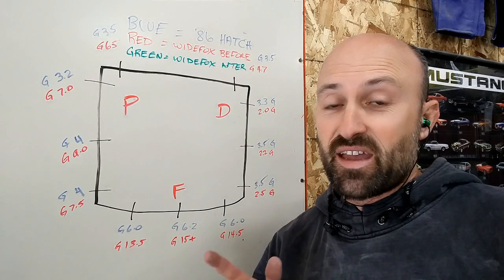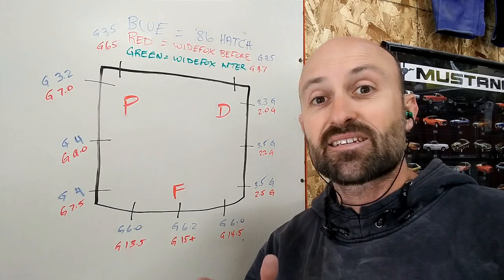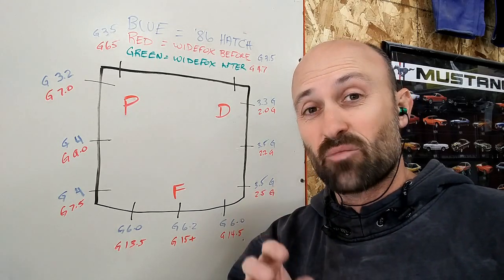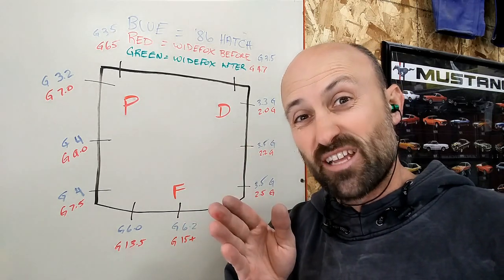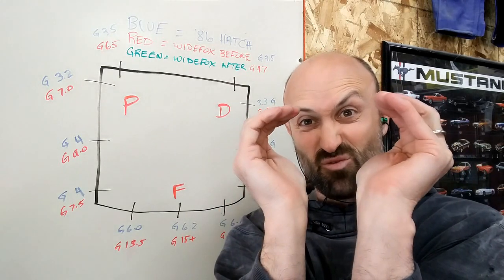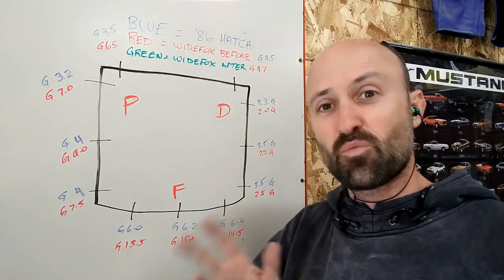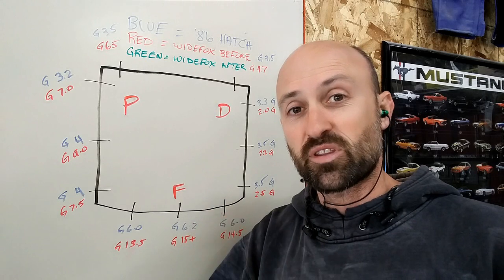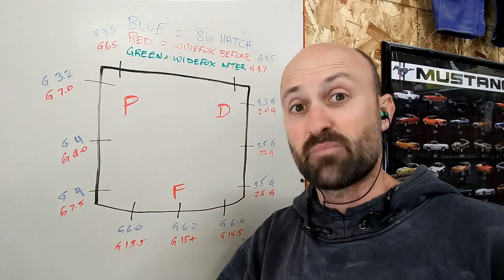One of the things that you'll notice on most cars is that your eyes can tell a difference in sizes. Not necessarily, unless it's calibrated, what size it is, but you can visibly look at something that should be straight, and you can tell if it's gapped this way, gapped that way. You can see the difference. So before you start fitting any panels, you need to put them in what you think are going to be their installed shape, and then take some measurements.